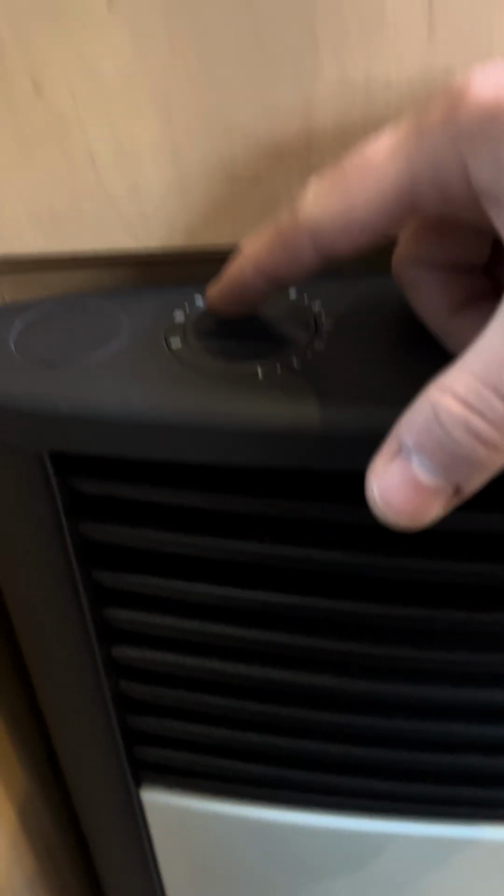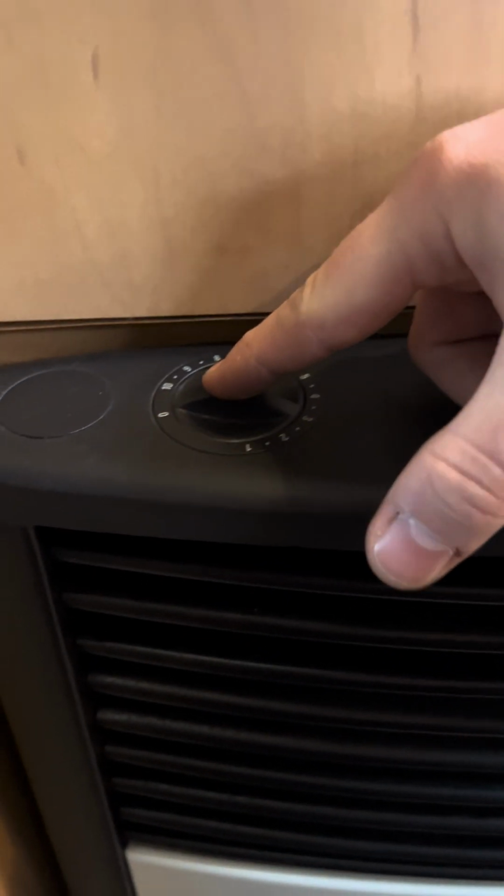And again, I'm not sure if you can hear it, but there is an igniter clicking away inside there now. And all I'm going to do now is press down on the button. You can see there, we've got our pilot flame on, which is what happens when you press and hold on this. And now all I'm going to do is lift up on the tab. So I've let go of that now, it's still on pilot.